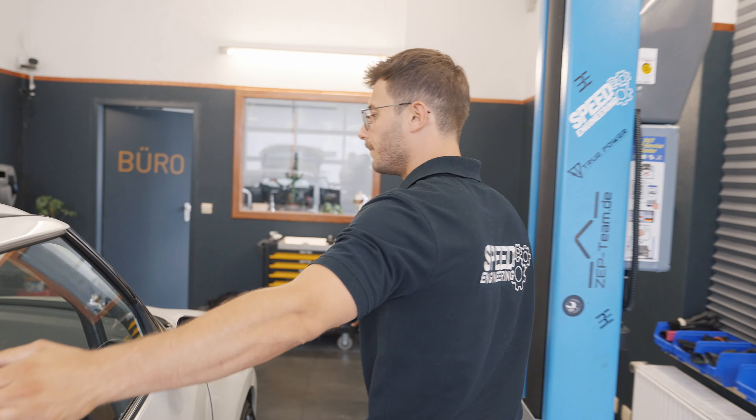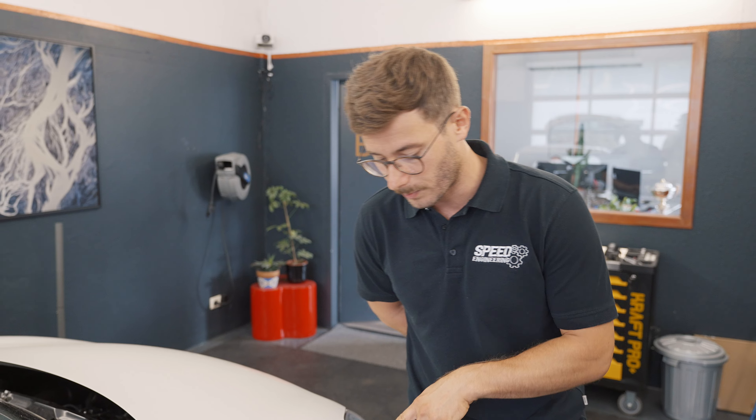The next point: the car already has a KW V3 suspension and what we have done is we will try to use this suspension before changing it. I know there are better suspensions on the market, also from KW like the Competition, or from Öhlins. But we will try to use this one with a different spring setting. We have a higher spring rate in the front but kept the same spring rate on the rear because the car is far too light in the rear, and making it too hard could lose grip. We also changed the helper spring and main spring on the front and kept the normal spring on the rear. We'll test it on the track and may have to make changes again.